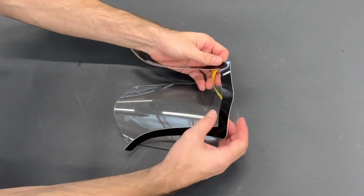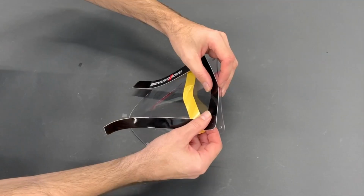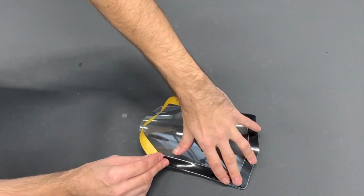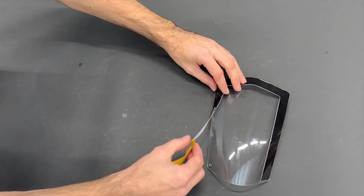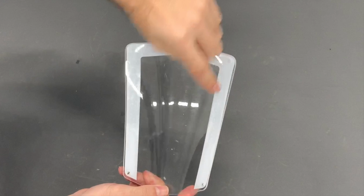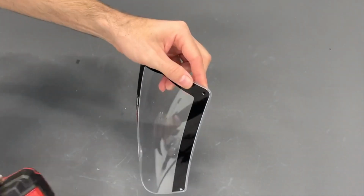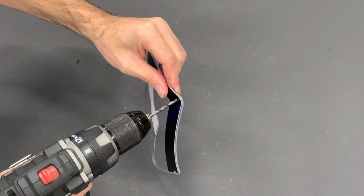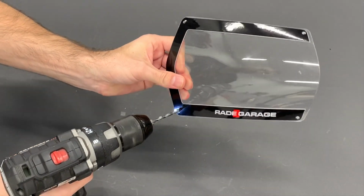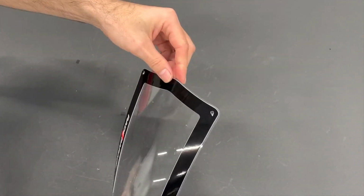Now you take the sticker and you put it on a plexi cover. Here in the cover there are pre-drilled holes, but not in a sticker. So what we suggest, you take a 4mm drill, you mark it from outside, and you drill it through. Yeah. Now you can clean up a little bit, and then you can use.